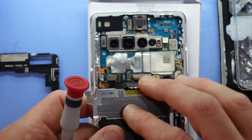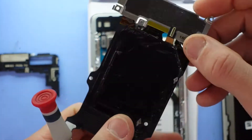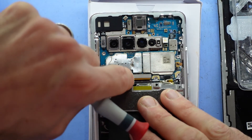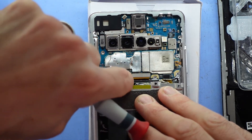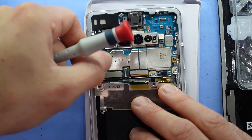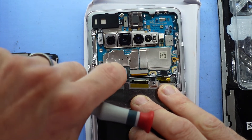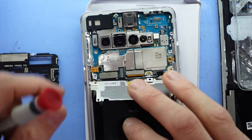Next up from here we do have a slight challenge — this one here which I believe is for NFC. Fold that over and push down on the connector as well. When you're in the right spot you should be able to wiggle it, just push down — there we go, that's on. Now we'll reconnect the battery. Battery connected: USB, NFC, display, USB, power button.